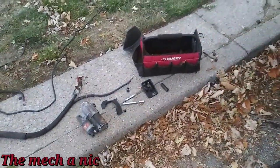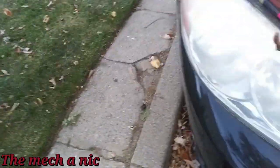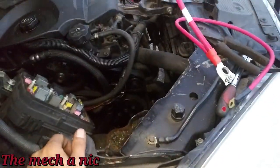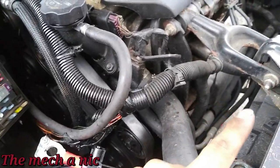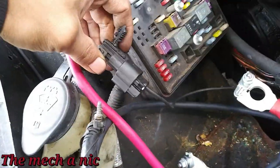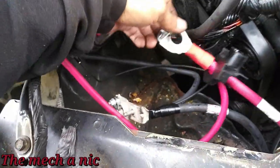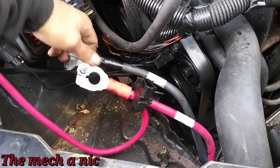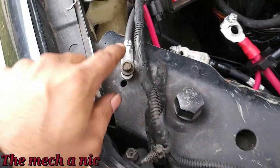I would start putting everything back together with the new parts and I'm eager to do it, but I'm losing daylight so I'm just going to throw in the towel for today. The starter is bolted back up, all wires are connected to the starter, I've got my ground going to the engine, this is plugged in, got the ground going to the body. I still have to tighten this down, but other than that it's ready to accept the new battery. Power goes on this side and ground on this side.